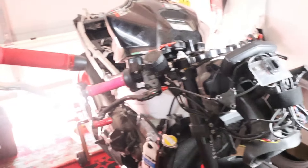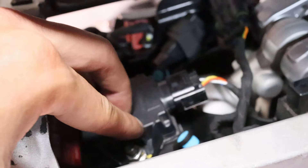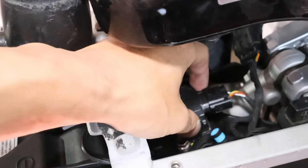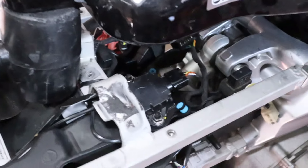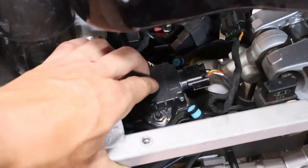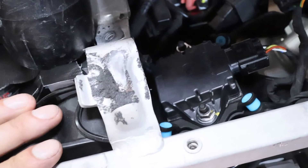The damper is on. You can see the little rubber springs — if I press on it, it bounces. It's the same concept as those phone mounts with dampening rubbers that street riders use because phone sensors go out of whack from vibration. The IMU is now elevated off the subframe so it's no longer in direct contact with the chassis.